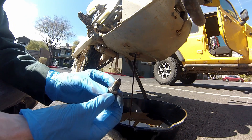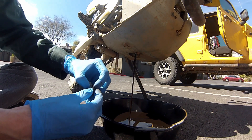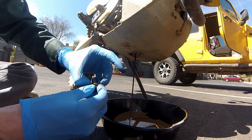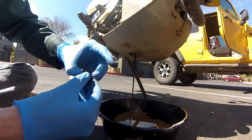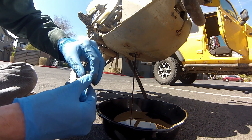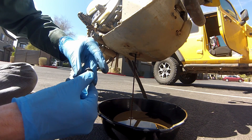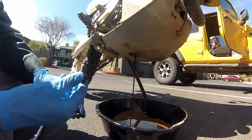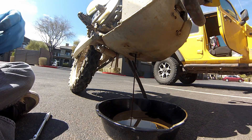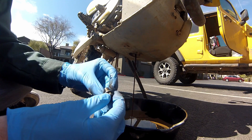When you take it off, make note of the crush washer — each bolt should have one, both on the crankcase and the frame. They're both kind of stuck, but unscrew it or pry it loose. Some people say you can reuse these, but I do not recommend reusing a crush washer. When you crush it, it's supposed to take the form and seal it tight. And they're also like 50 cents, so it's definitely worth it to just get some new ones.